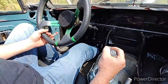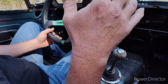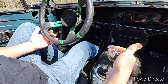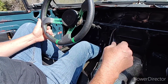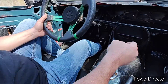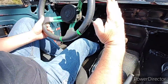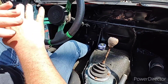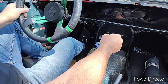Downshifting is more difficult because you have to rev the engine. First, you've got to slow your road speed. We're still in fourth gear. We're going to give it a little rev to get it out of gear, because it's easier to get it out of gear under power. Give it a little rev — we revved it, and on the way down from the rev it fell back into third gear because I had a little pressure on it. No grinding whatsoever.